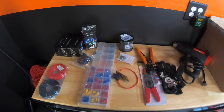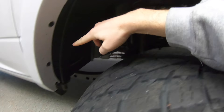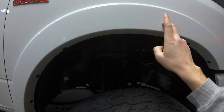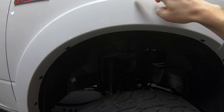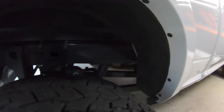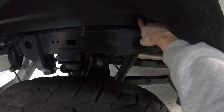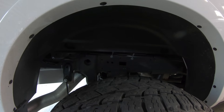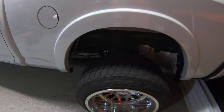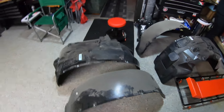To break down these fender liners, there are two 8mm bolts right here and then all these going around. If you have a Laramie, don't worry — your flares will stay on, they're tacked in up top. For the rear it's the same: all these 8mm bolts, one right there and one right here. The fender liners are all out now. The rears are a little more of a pain than the front, but once you get all the screws out and the couple little black pop rivets, it's pretty simple.